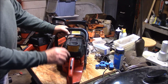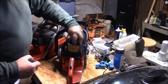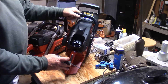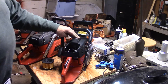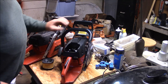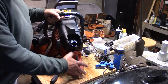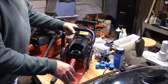The other modification on this saw and the blending of different models is not as obvious, but it's the carburetor. That is an X-Torx carburetor adapted to the original edition 48mm 2165 cylinder. I did a whole video on it so I'm not going to go back and do it again. But one of the things I got out of this was a lot more power. I can't explain all the reasons why, but I've also made a fair amount of modifications to that whole system. It's not something you just take off the shelf and bolt onto the original edition saw.